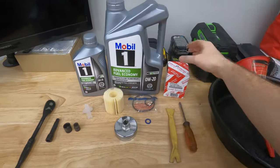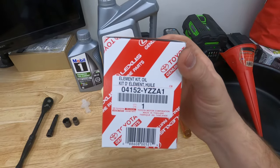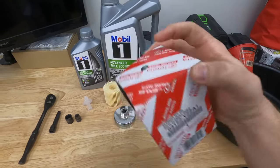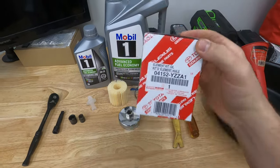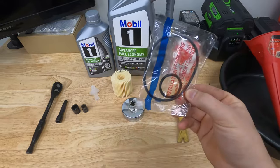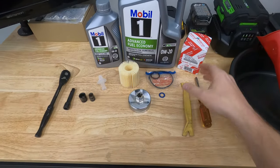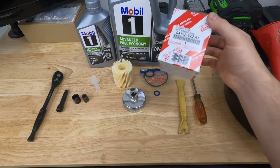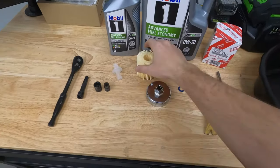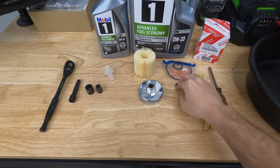So first and foremost, this is a cartridge style filter — it looks like this rather than your normal spin-on filter. Here is the part number for it. I'm actually using an OEM filter just because honestly the price is not that bad at all. I'll pop that up in the corner. One good thing is you're having to change the o-rings, and it's the same ones that came from the factory. Sometimes aftermarket filter o-rings could be better or worse, but since our car is brand new I just want to make sure I use the Toyota stuff in case there's any warranty issue — I can show that I've been using their parts. It comes with both o-rings that you'll need, the cartridge, and your crush washer for your oil drain plug, so you'll be able to replace that as well.